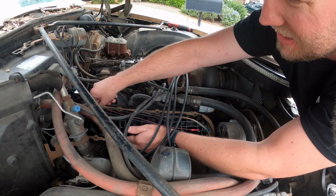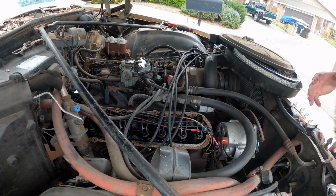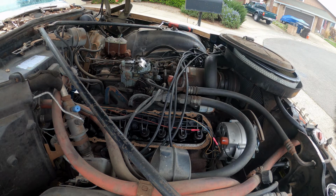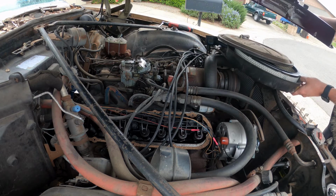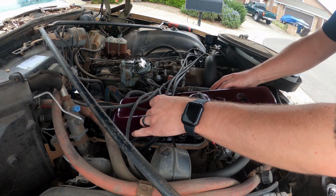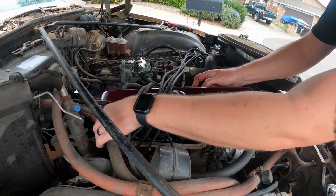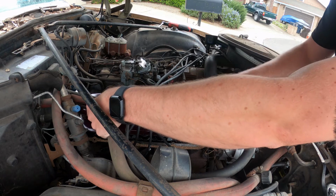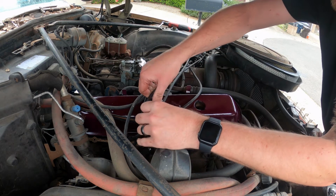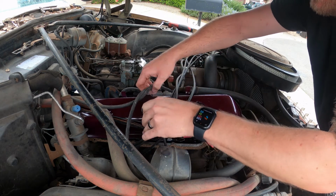Gaskets are relatively easy to see where they go because the holes line up very well. So now that's on there, time for the valve cover. Alrighty here. And now valve cover should go on relatively alright. And as long as you remember the orientation of how they were placed the first time, then it goes back the exact same way.